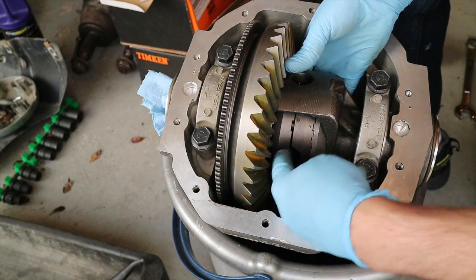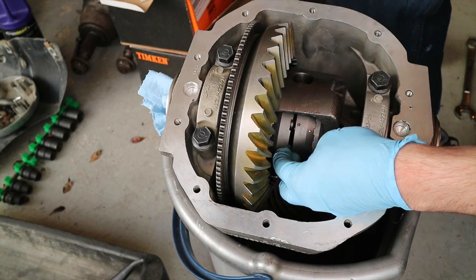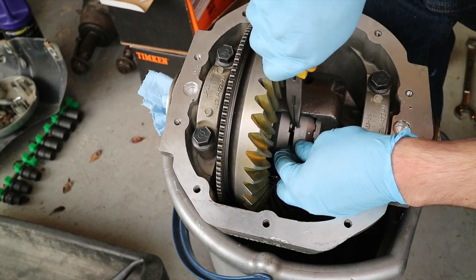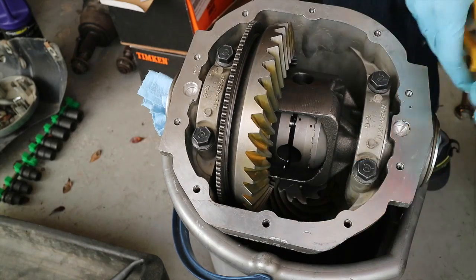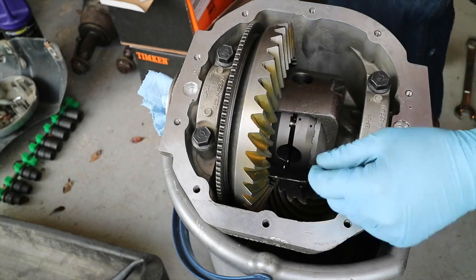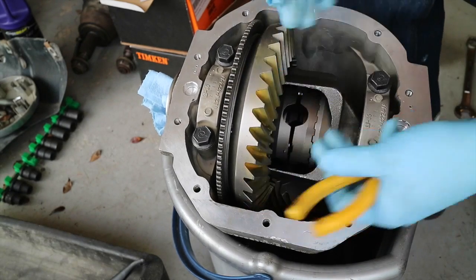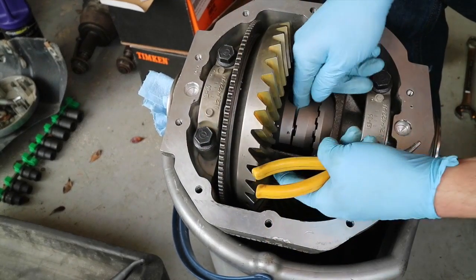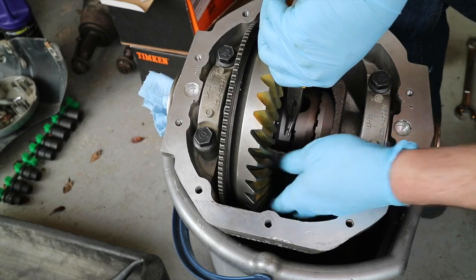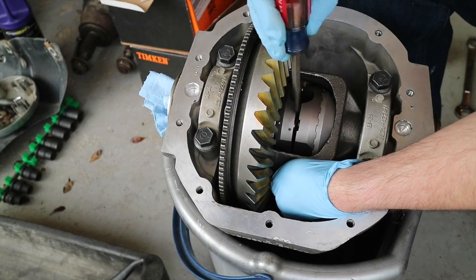Get everything lined up, then start to pull your retaining pins on those spring-loaded lock nubs. Be aware that they can fall into the case — I was able to fish mine out from the bottom. Be very aware of that and keep track of all the locking pins. If you nip your pins just small enough, you should be able to rotate the entire assembly inside the differential housing without those dragging on the inside. The way they come from the factory they're twice as long — I nipped mine in half. Pry it apart with a screwdriver and pull the pins.